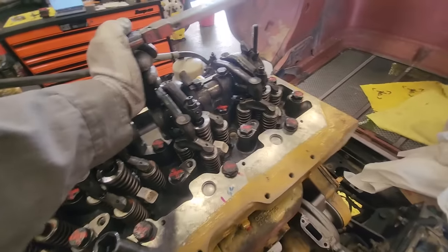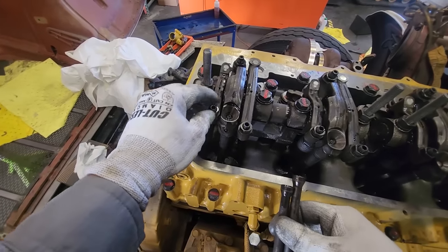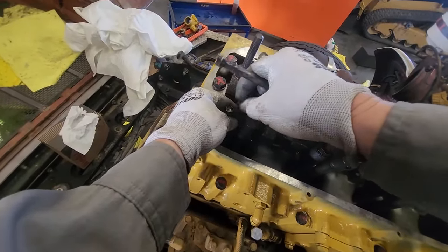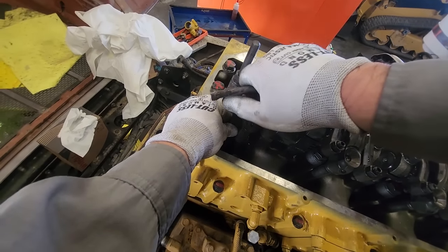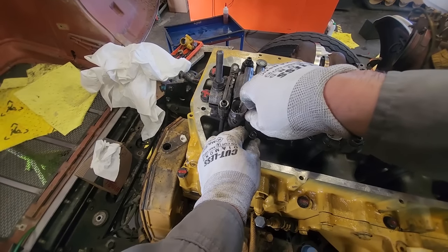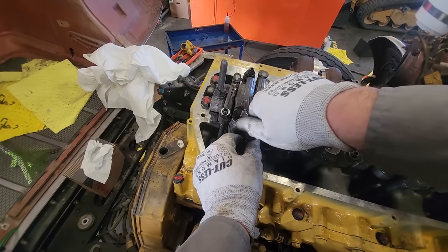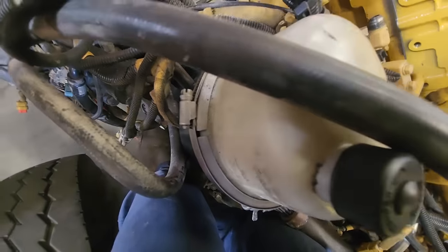Before we start our overhead, you have to put your pushrods in. The reason I put the pushrods in after — and I do this on C7s also — is because I don't like torquing the bolts for the rocker pedestals while there are a bunch of pushrods installed pushing down. It's trickier, and it's hard to get all six lined up — four valve and two injector pushrods — while you're trying to get four bolts started and two alignment dowels for the pedestals. The injector pushrods go in first because it's almost impossible to get them in once the rocker assemblies are installed.